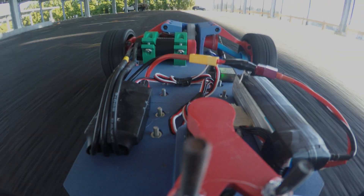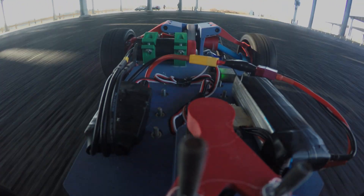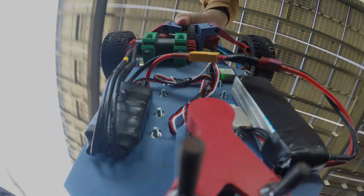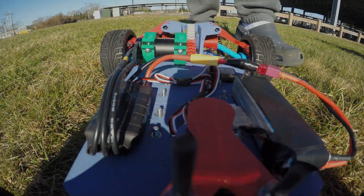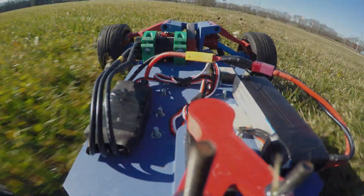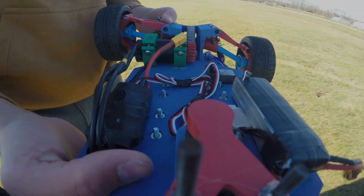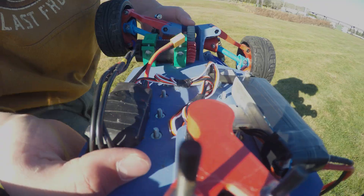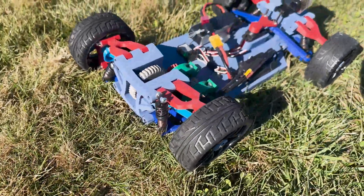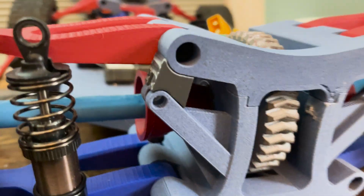I was driving this thing around, swerving through the parking lot roof columns, and then had the brilliant idea to go run it on the grass. This car was not designed for off-roading by any means, but the first person footage from the GoPro was pretty awesome — you could see the suspension working so well. Eventually, this unfamiliar abuse would target another weak point on the car: the suspension braces. When originally designing this car, I was literally just designing a computer model to simulate different suspension geometries, and then it evolved into a whole project that's lasted like five months now. Originally I just needed a hard point in space to attach the suspension to in the computer, so that's what I made. In the real world, however, this hard point is very poorly designed and is probably the worst designed part on this car. Once back up on my desk, I made this little part — it's so stupidly simplistic, I'm actually annoyed I hadn't thought of it sooner. All it does is distribute the force experienced by the suspension better into the frame.